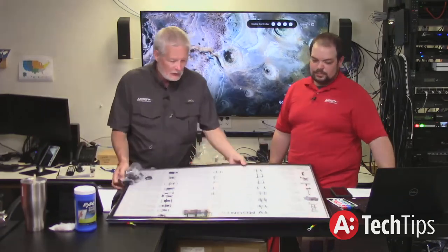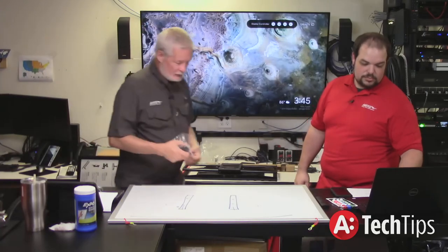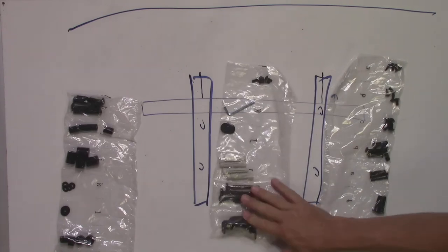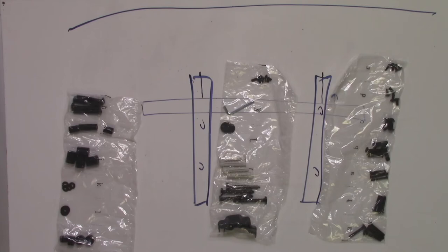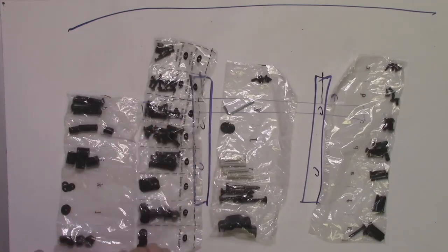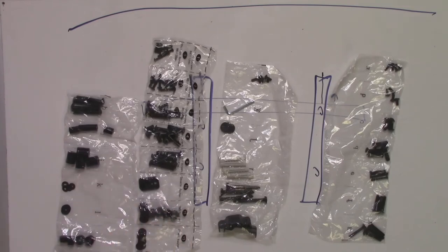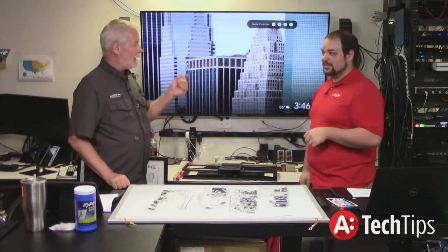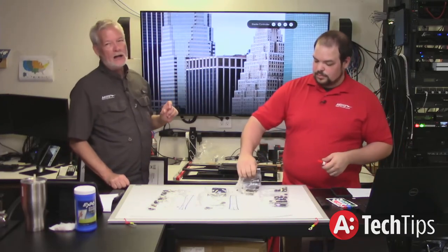Regarding hardware: there's a lot of stuff in the kits, but invariably somebody brings out a new TV with a different screw length or diameter. For example, Samsung came out with a TV requiring a much longer bolt to reach from the mount to the threading inside the TV. Also, not all bolts have the same depth on a television — Sony, for example, will have shallower bolts at the top than at the bottom. Do not screw through your panel. On the TV itself, I highly recommend using a hand-operated screwdriver, not an impact driver, to avoid cross-threading or piercing the panel.